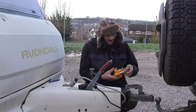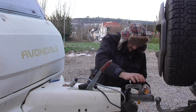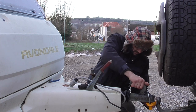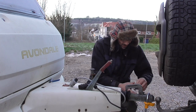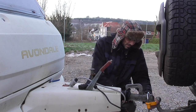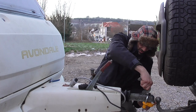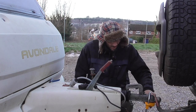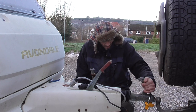The bar doesn't come all the way out, which is a good thing. So all we need to do is turn it around, lift that up and clunk it in. Put the bar down — there you go — and it even ratchets itself into place. That is now not coming off. That can be undone but you're not going to get past that. We've now got a nice hitch lock. If I turn it around, the bar will be too far forwards and it'll be easy to unlock it.